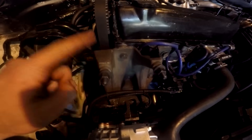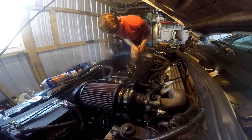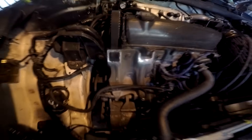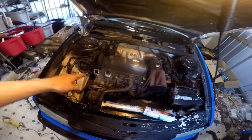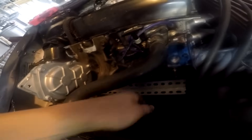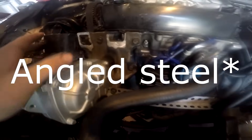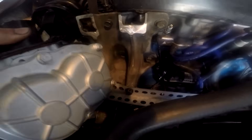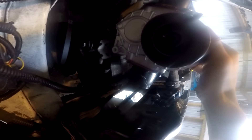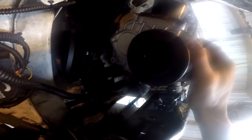This is how that went. First thing I see for mounting — these brackets have got to go. Once that's done and cleared, I put a piece of angle iron onto the old AC bracket. My engine bay is filthy, my shop smells terrible, and I hate cutting aluminum. The bracket will sit like so and I'll weld some sheet metal there to bolt the lower mounts on.